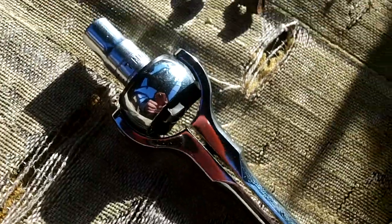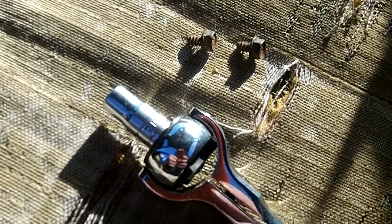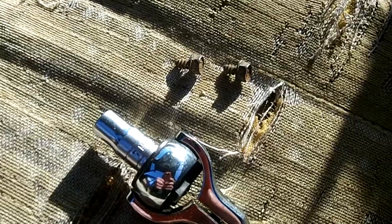What it's held in place with is these two little screws — they're a 7mm head, that's a quarter inch drive there — and you just have to find them and back them out. They're not in there very tight, and you just make sure you don't lose them because you're going to need to put the switch back in place.